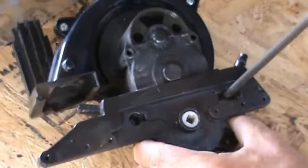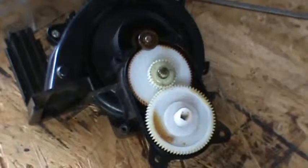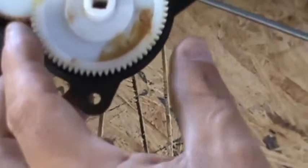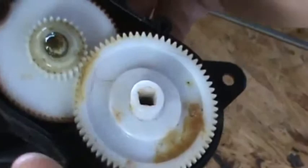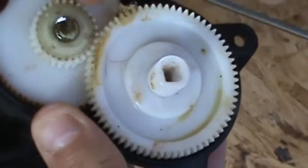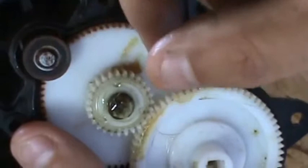On the bottom side there are two more Phillips head screws. We're just going to pull these two and this will get us into our gearing where we can investigate. You can already see there's some rust in there from the water that you use with these things. When you get the gearbox opened up, you want to inspect the gears — obviously if the teeth are worn that would be your problem. All my teeth look good and you can see there's some grease on here.